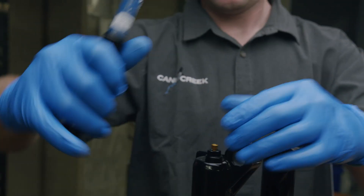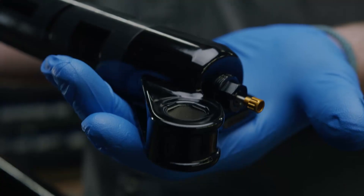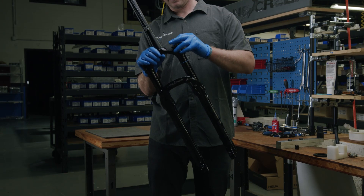With your travel adjustment completed, add the desired amount of PSI and charge your negative air spring. Remember to reinstall your protective caps.